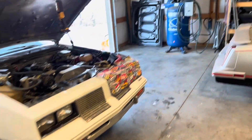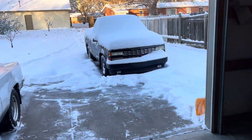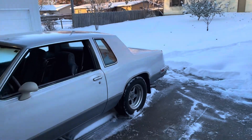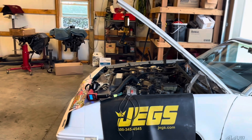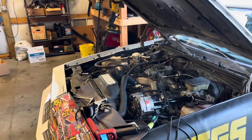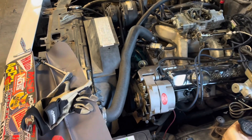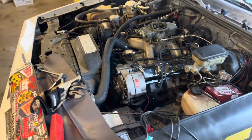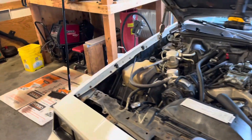It's cold outside but supposed to get decent — I need to get back to shoveling snow. Let me check if I'm recording — okay, I am. The timing is set around 17 degrees initial; it might be 16 or 18, it bounces around a little bit. I've been letting it warm up and letting the coolant settle.